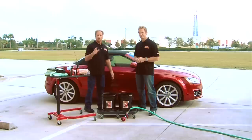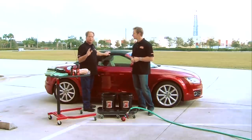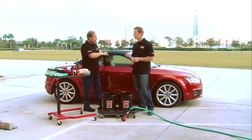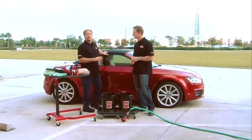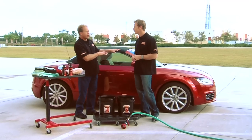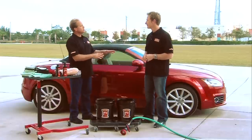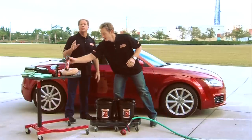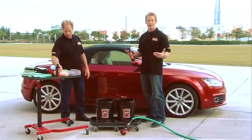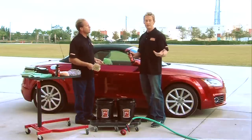Here's a little tip. Most people say to start at the top and work your way down, but a better way is to start with the wheels and tires first. Knock out all four wheels and tires, and that way as you're washing the rest of the car you don't have to worry about the water drying on them. So we're going to start with the wheels and tires and show people a couple tools and some tips and techniques to really get these things clean. The whole idea is to use the right product for the right area and the right tool to do the cleaning.